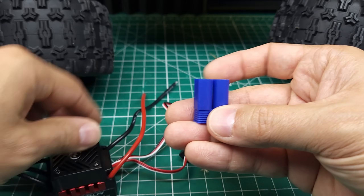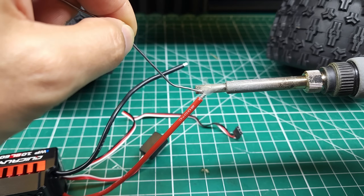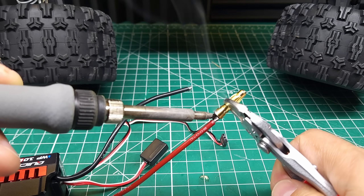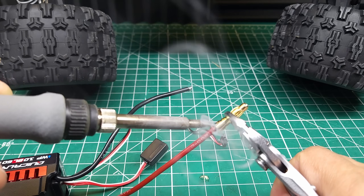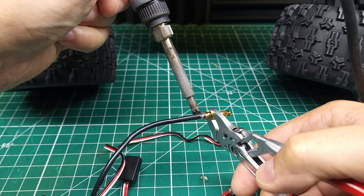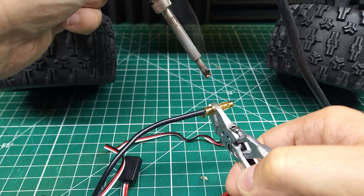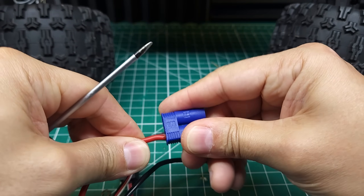Before installing, let's put a connector on. I'm going to use an EC5 since that's what most of my batteries use. You could probably get away with an XT60, though it might be on the edge with the 360-amp burst current. I got these EC5s on Amazon and they work really well — they snap in from the back and I've never had problems. What's your go-to connector? Lately I've been using mostly XT90s and QS8s, though EC5s are easy to connect and have a higher amp rating than XT90s. Let me know in the comments, and if you enjoy reviews like this, get subscribed.